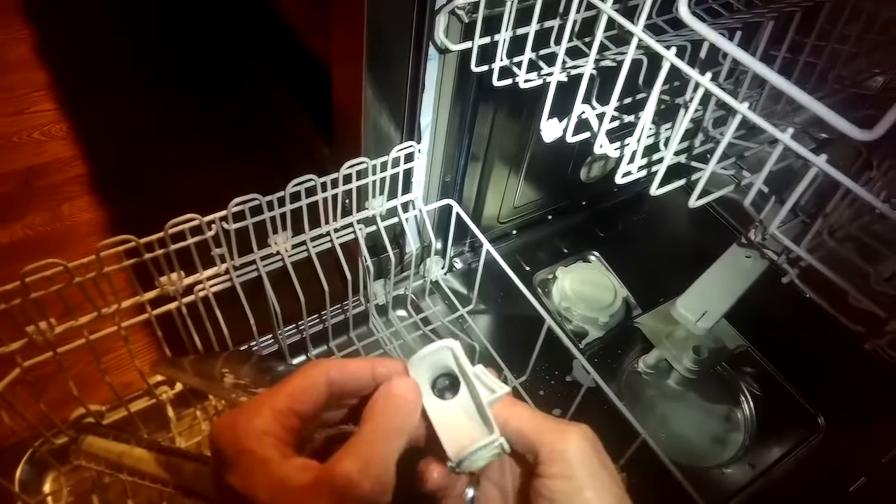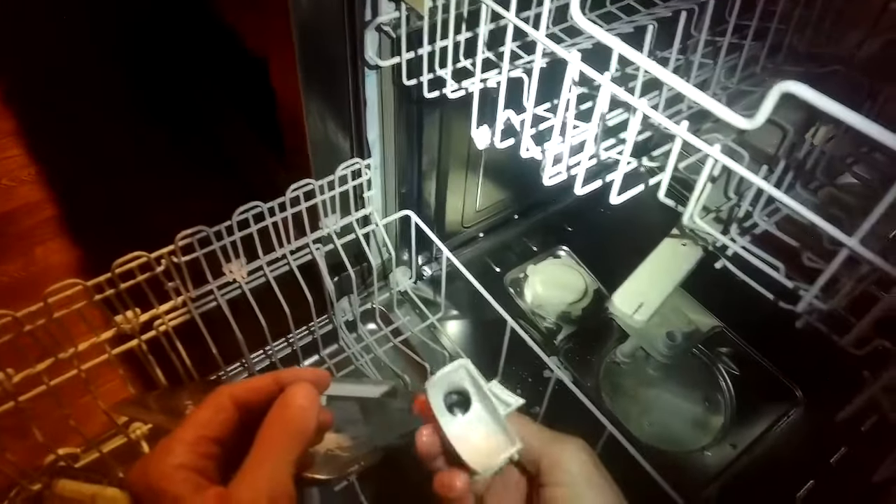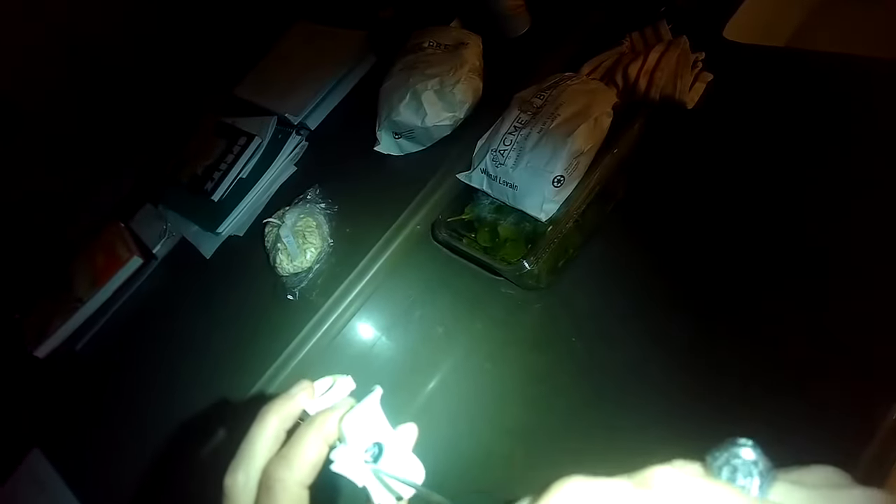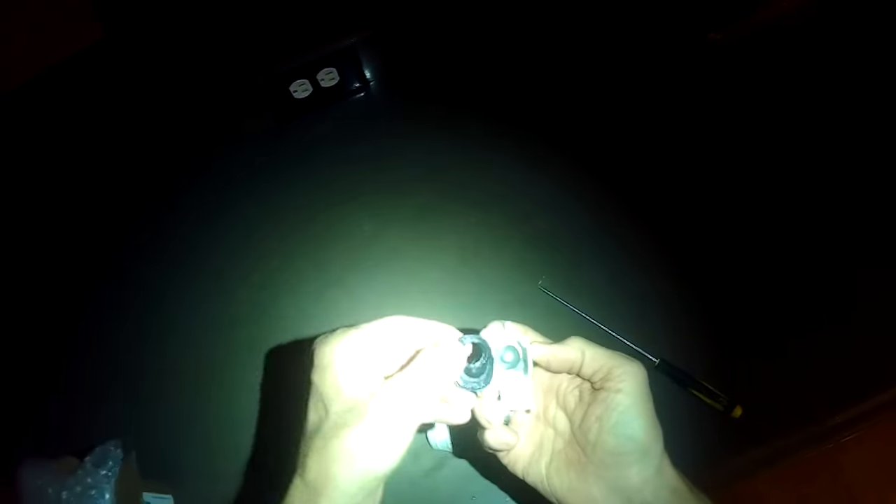Sometimes you'll find seeds in there too. When things get caught in there, the ball bearing is not able to sit down with gravity into the rubber gasket, so water that had drained through the drain tube on its way out of the dishwasher can flow back into the dishwasher — and that can cause flooding. So probably this dishwasher was being flooded not as a result of a bad fill valve but just this little piece of plastic caught in here. I took this apart by pulling the two sides apart, took out the rubber gasket, and removed the ball bearing with that little piece of plastic. If this video is helping you, please consider pressing the subscribe button in the lower right corner of your screen.